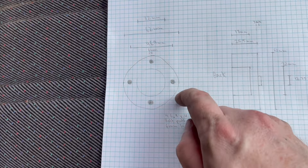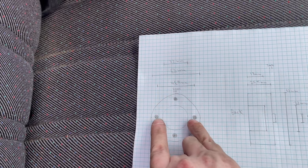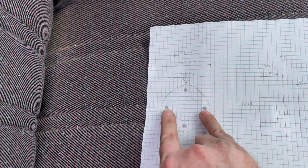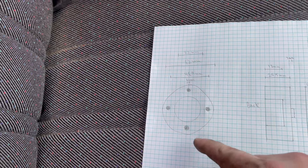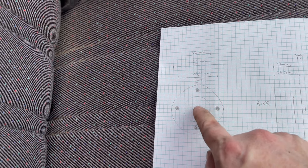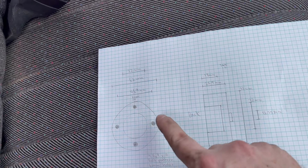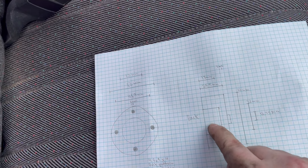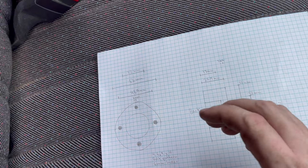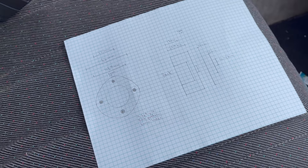So pretend this is perfectly round — 62 millimeters wide, and that fits down inside the crank pulley. The hole centers are 46.9 millimeters apart; there are 6-millimeter holes that might have to go up to 6.5mm to accommodate the fat shank on the bolts I bought. It's essentially a 46.9mm four-bolt pattern. This center hole is 32 millimeters across. There's a big negative space for the center crank bolt, and flat mating surfaces that butt up against the interior of the crank pulley.